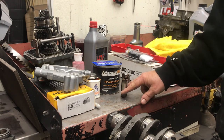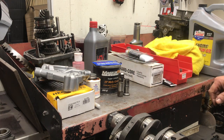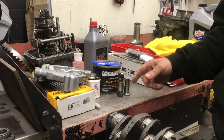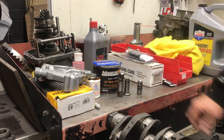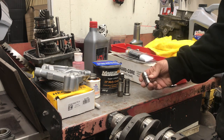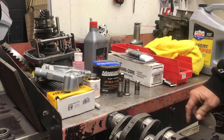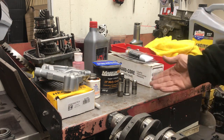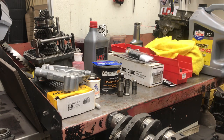I've got some people helping me with my motor who are a lot smarter than I am. An old-time NASCAR guy who works at this lifter place gave me an idea of something they used to do in NASCAR. They're not allowed to use roller cams either — or they didn't used to be — so what they used to do was use a ball bearing lifter. It's much lighter than a roller, and you can put the push rod wherever you want. You get the benefit of a roller cam without the roller lifter. It's experimental stuff — we'll see.